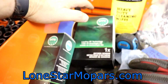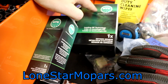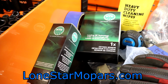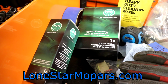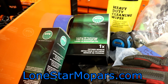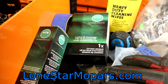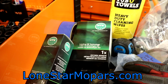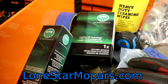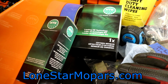So anyway, I think what I'll do in the next video, we will try to come through the cab. It seems like way back in the day, I remember hearing that if you were four-wheel drive, you could go through the boot and the shifter and get to the top of the plug, because you can access the O2 sensor to pull it and make everything golden. But then the issue is to disconnect the upstream one. Your connection is way on the top of the transmission and I can feel it, but I can't really get two hands up there, and I can't see anything that I'm doing. So it's a total nightmare.